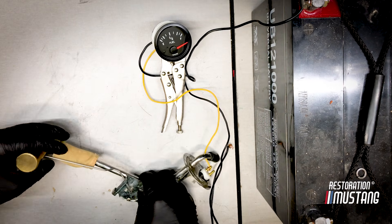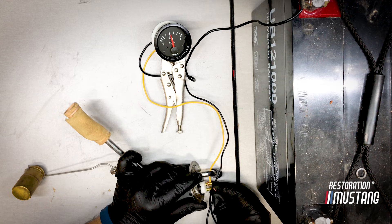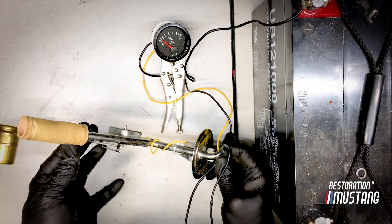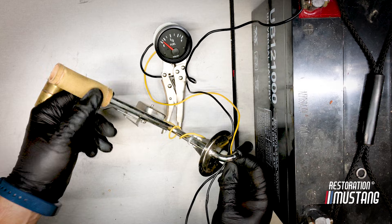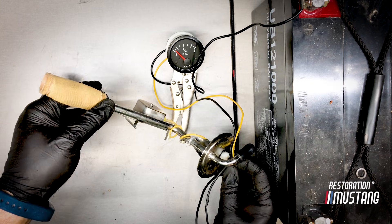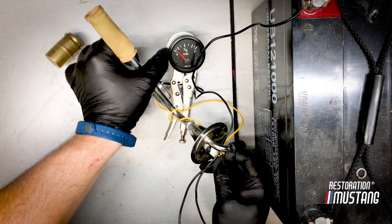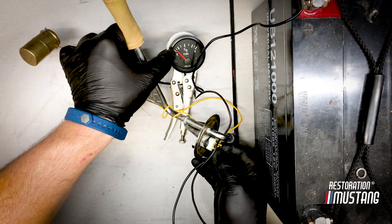You'll notice the gauge is going to go up and down. If I reground this — this just popped off my little demonstration bench. This is going to represent empty. When this is sitting in the tank in this orientation, this float ball down here swings up and down. That's going to represent empty. So the way you can see if this is calibrated correctly: drop the ball all the way to the bottom and that's empty. If you see the gauge is a notch above E, make sure when you're driving the car that you note that actually is truly empty — on this car, one notch above E means I need to get to a gas station.